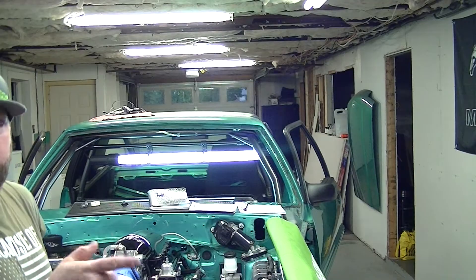I made sure the trans brake and anti-lag worked — that was a pain in the ass because I was using Nitrous One as an output and it kept telling me there was something on it. A friend online looked at the tune and said something was a little weird, so he sent me his setup. I have it on Nitrous Two now and it seems to be working fine. I brought the car up on anti-lag for a quick test and it worked. I can't test the trans brake because the driveshaft's not in yet.